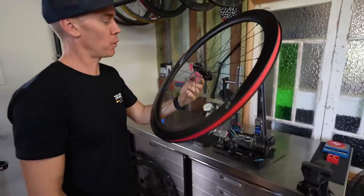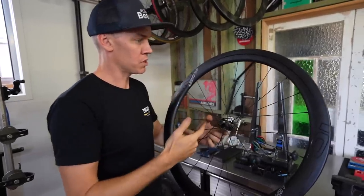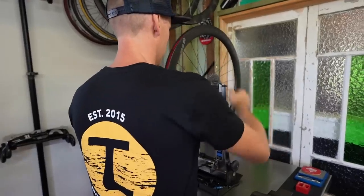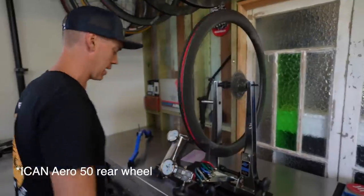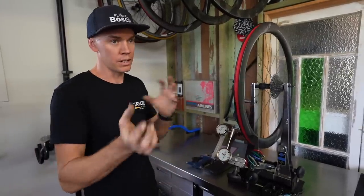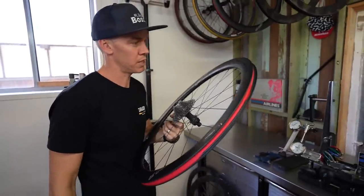If I was going to a budget wheel, you'd probably get those. You've got usability for the nipples — easy to do at home. You've got normal spokes. You've got a conventional bearing you can knock out and put new ones in and upgrade them for maybe a couple hundred bucks — you could really pimp the hubs up. You're getting a really good wheel for not much money. The rear bearings feel not too bad. Dish is slightly out, minimal, passable — 100%, no drama. Compared to any brand — Zipp, Fulcrum, Campagnolo, anything — they all settle and need to be trued slightly; I don't see that as a major problem.